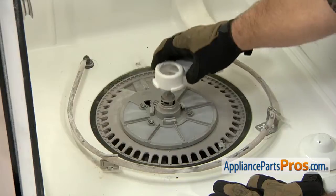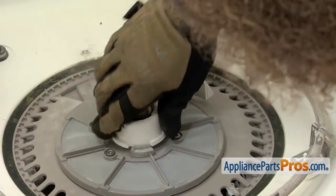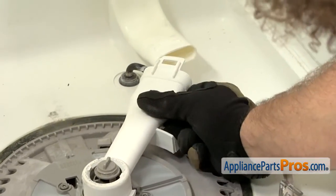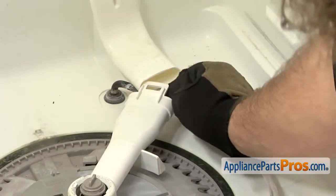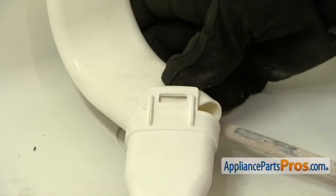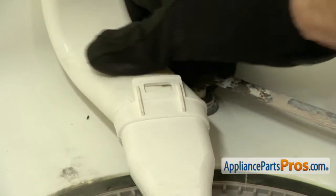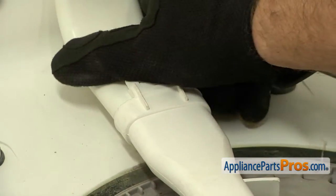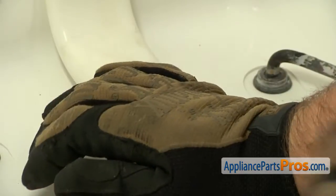To put this water tube back in, you want to line up the three notches so they go down into the pump body like that, and then you have to kind of lift up on it while you get this other side of the tube in there so it goes in properly. You can push them over so they're up at 12 o'clock and make sure that they latch together.